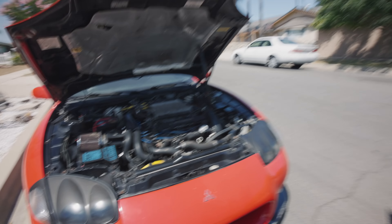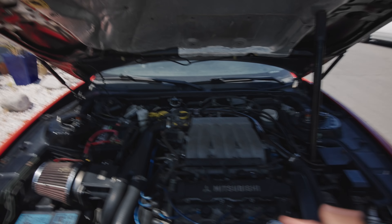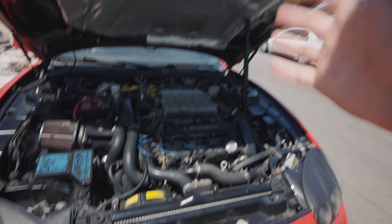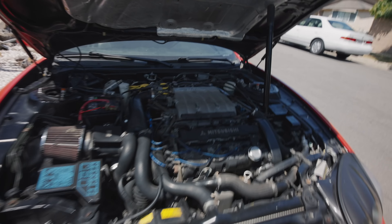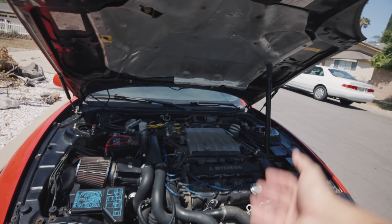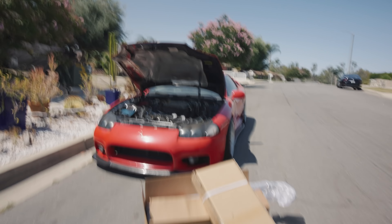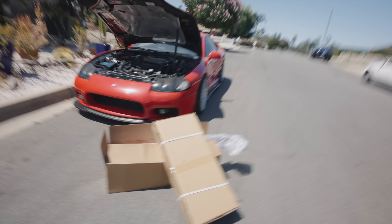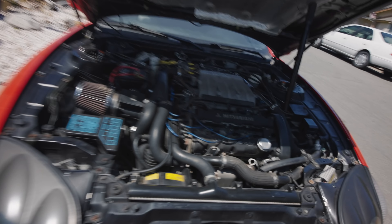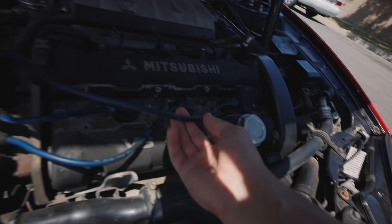Today's objective is to take out the OEM injectors, have them cleaned, put them back in, and take out the spark plugs to check the gap. I did change out the spark plugs previously but never pre-checked the gap, which was a big mistake. I also want to redo the valve covers because they look pretty ugly. Huge thanks to everyone who commented in the previous videos to help diagnose the car — without you guys this would not be possible.